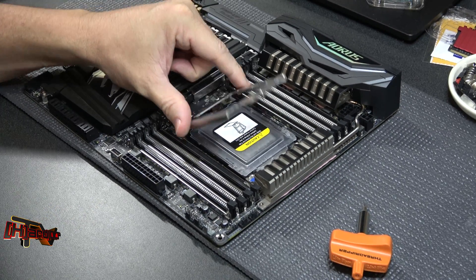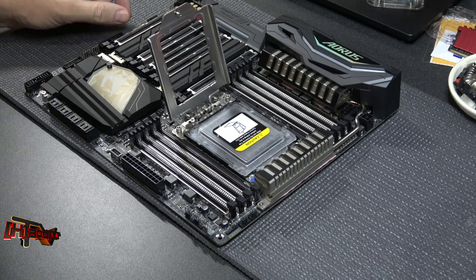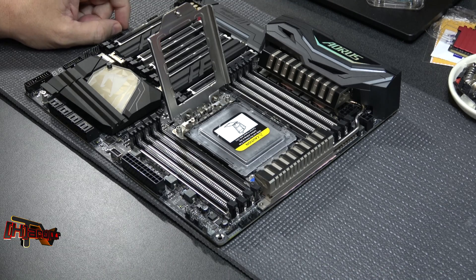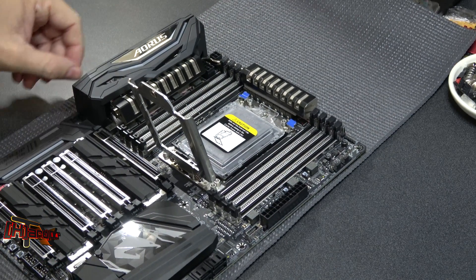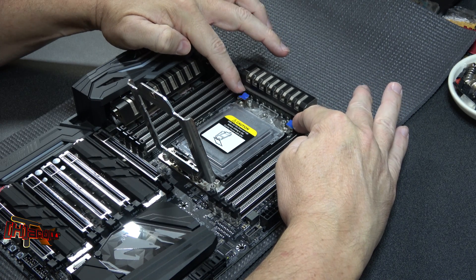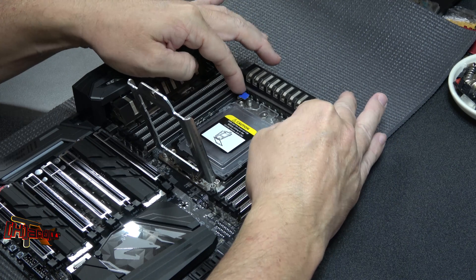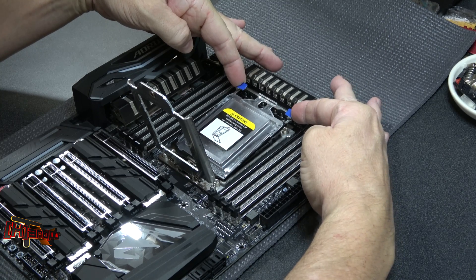Pretty nifty. Now the next thing you're going to want to do is open up the actual location device for the CPU itself. Let me get this turned around for you. What's important here is you see these two tabs on this end — these are actually colored blue on this one. I do not know if all motherboards will be this color, but you have the two tabs that show here. So what we want to do — and this is a little bit tricky and it doesn't feel really right — is pull up just right there on the tabs and it'll pop up.